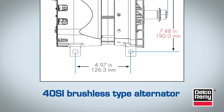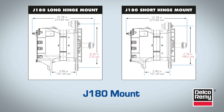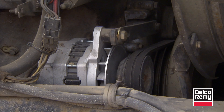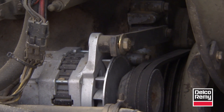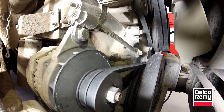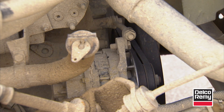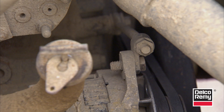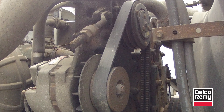Some competitive-type alternators also have the longer 4.97-inch pad mount span. Now let's discuss the J180 mount. The J180 mount is available in two mounting size dimensions: a long hinge and a short hinge. If the engine alternator mounting bracket is an adjustable slide bracket mount, both the short hinge and the long hinge will fit in the bracket with no modification to the mounting being necessary. The alternator is used as the main point for adjusting the drive belt tension and can be slid looser or tighter to adjust accordingly. Additionally, different size alternator mounting spreads from different manufacturers can be used on that application as well.